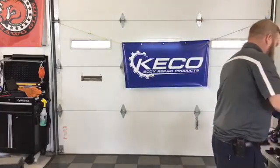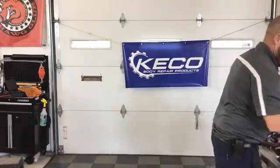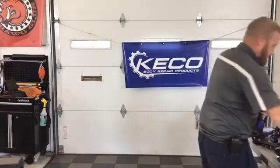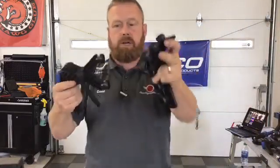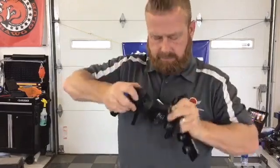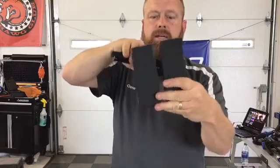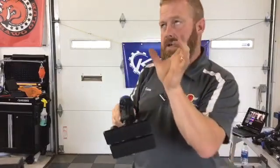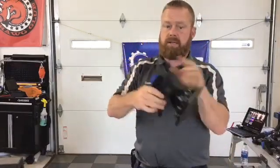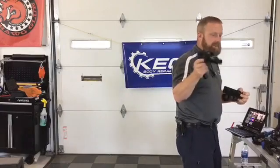From there, we can set up with our single head, have to pop this off. With your standard Robo, again, it's all part of a system. We can use our crease feet. These go right on, just like the kidney-shaped feet. And now, with your regular Robo and these feet, you are able to hold that metal down and get concentrated pulls on crease tabs, just like that. Even on the 6-inch or the full-size 7mm dead center tab, you can still get a great mid-pull with this. But wait, there's more. I feel like Billy Mays today.